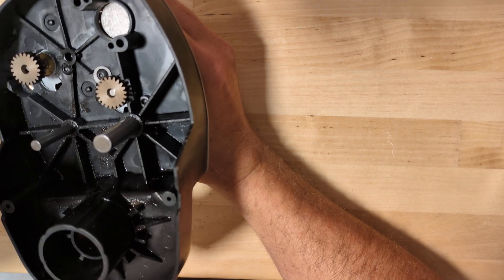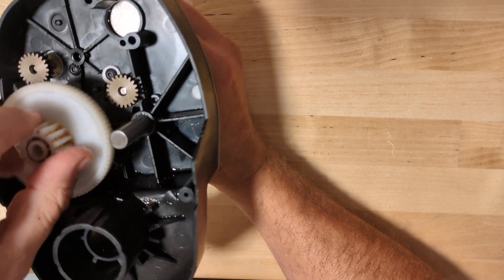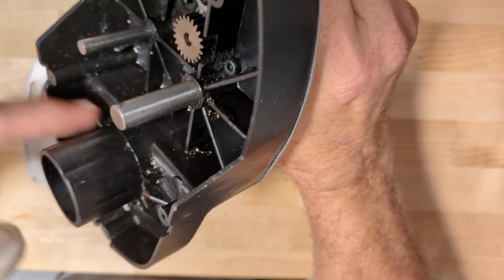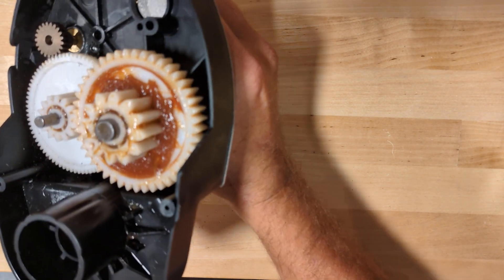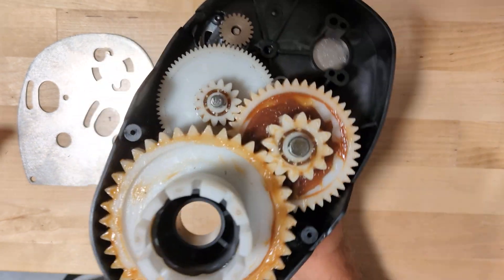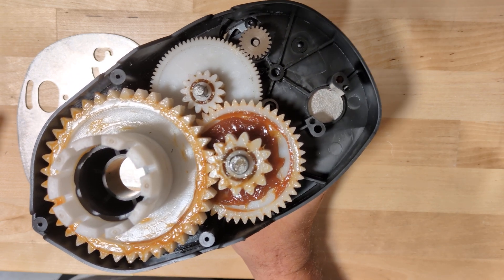Once you get that bolted on and tight, everything thread locked — be sure to grease the shafts. You do not need for racing to grease the gear at all. Nylon gears are kind of self-lubricating — that's not where the heat and friction are coming from. It's coming from the gear going really fast on the shaft. Our gearboxes also have extra grooves over a stock power wheels gearbox to fill with grease to keep the final drive gear going smooth. Once you're done, drop all your gears in, close up the gearbox, bolt it tight and go. If you have any questions, please email us. Mistakes at this power level and voltage level are pretty fatal, so talk to us before you experiment with anything.